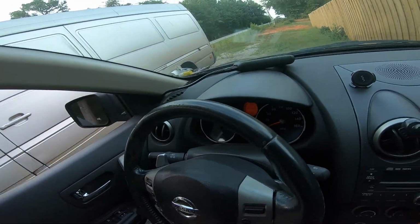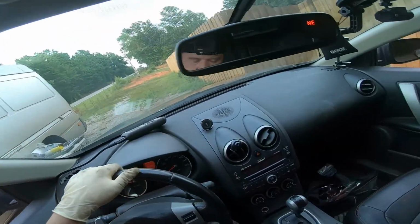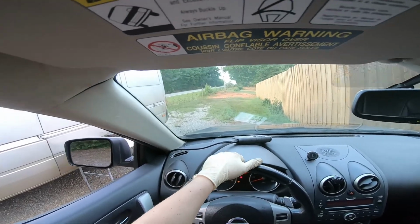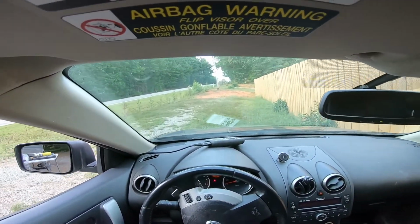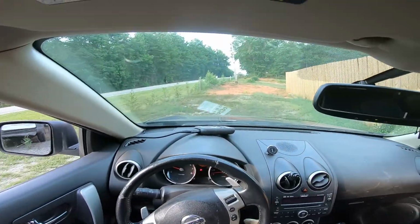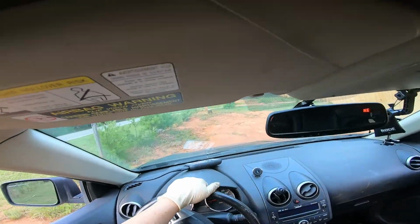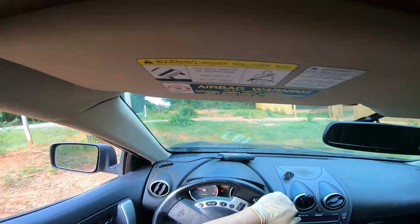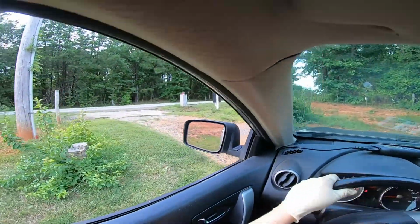So from the looks of it, it came on right away. This engine, this is the only logical thing to do, guys, is pop in all the new spark plugs, all the new coils, and see if that really helps, because if a coil pack messes up, then that's going to be the issue. But test driving will definitely give me a good idea if it has solved it.